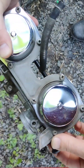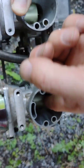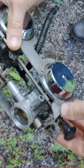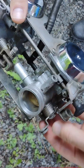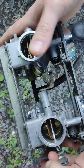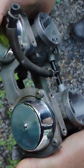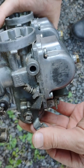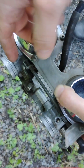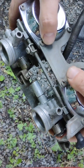If you're doing like me and you've got a carb bank that's all set up and ready to go, just do a few checks. Make sure the needle is rising good, your choke is coming in and out nice, and your throttle mechanism moves easily. I've already bench synced these carbs to be sure they're as close as possible before actually running the motor. It's got a fresh rebuild on it. I did set my idle screws — those are two turns out, so keep that in mind as your point of reference.